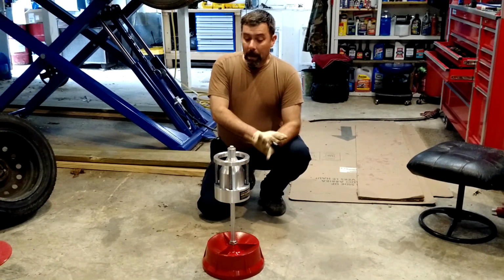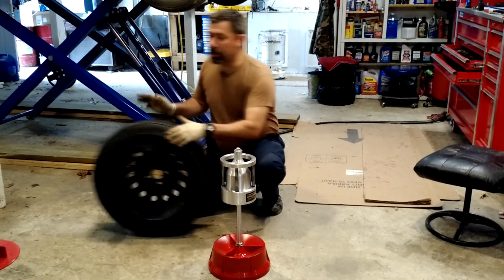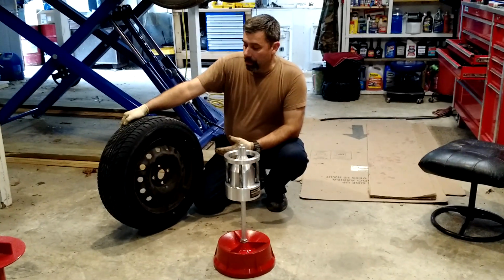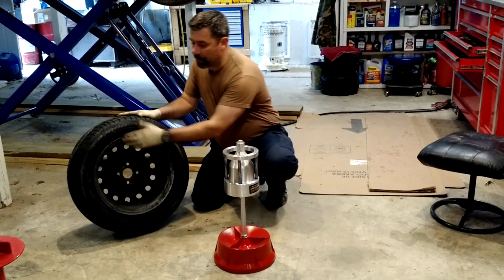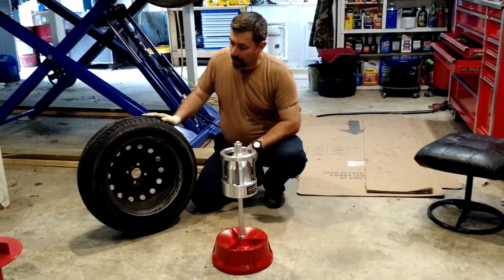But before we start, you're obviously going to have your tire. Now, in my other video, I used the Harbor Freight manual tire changer to put these two brand new tires on my Honda here. What you want to make sure to do before you do the balancing is to pull off any old wheel weights. If they're stick-ons, they'll be back in this area here. If there's hammer-on weights, they'll be here on the lips. So we're going to go ahead and do that.